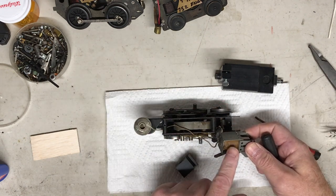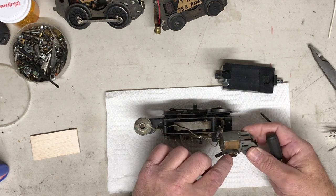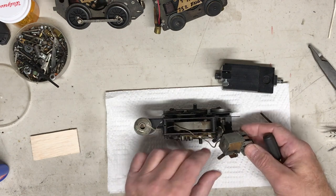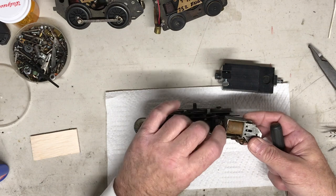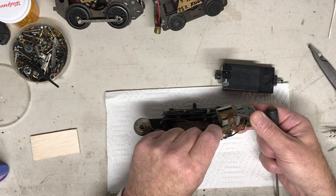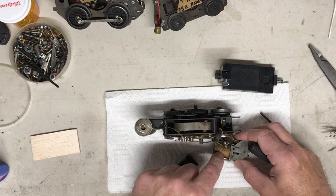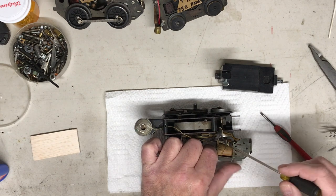You take the coil out, and you'll probably have to disconnect the wires, which is not a big deal. Just gotta keep track of what you're doing. Mark them if you need to, but the top wire coming out usually indicates it's on the side of the contactor. The other side, the wire comes out at a lower point most of the time, either somewhere near the middle or near the bottom.